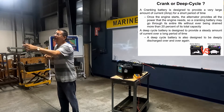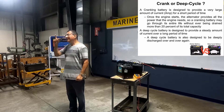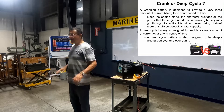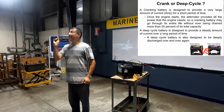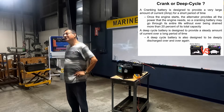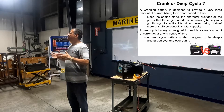But I have another battery with thinner plates. It stores energy but releases the energy faster. What type of battery? Cranking battery. That's why the deep cycle batteries are heavy in comparison with the cranking. The cranking batteries are a little lighter because the deep cycle plates are thicker. Those are the main differences between deep cycle and cranking battery.